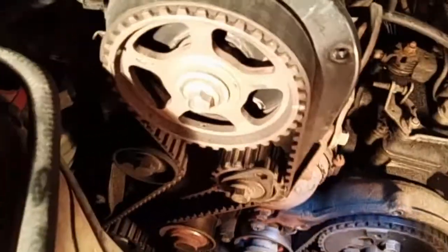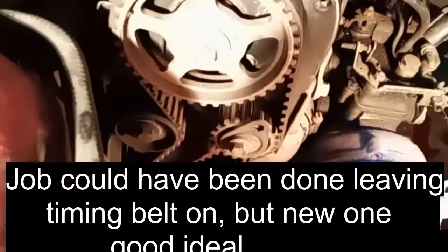Okay, so in here now I've got the dynamos off and the drive pulleys off the crankcase. Under there, the crankcase pulley's off. That's ready. And now we've got the timing covers off, all ready to start stripping the timing covers down. So it's just a matter of taking the 2 belts off. Well, I might only have to take the 1 off, I'm not sure yet. But as soon as I do, it's 3 bolts in there and I can let the pump off.